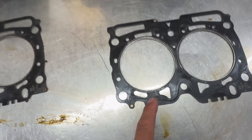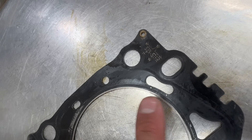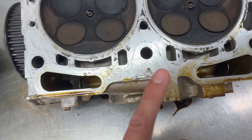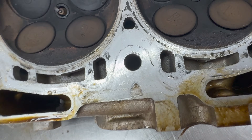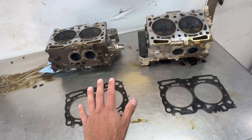Here are the heads. They actually have MLS gaskets and they are from Six Star. If you know about Subarus, Six Star is a great brand, and we can see the machine marks. This head has 100% been resurfaced, so these have already had head gaskets done. I actually just did head gaskets on a 2009 Forester and it was still having an overheating problem. I pinpointed it to a clogged heater core.